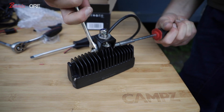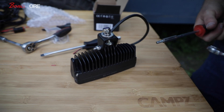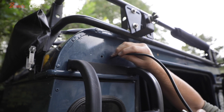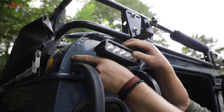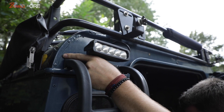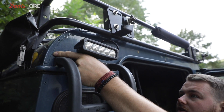A little tip I'd say is to do this up on the bench because it's quite hard to do once it's on the truck. So get it up nice and tight and then you don't have to adjust it again. So you've got the two holes here — obviously you want to do the cable first so you don't have to mess around after. Thread that through just loosely and then the other one goes through there. You've got the bigger washer on the back, followed by the sprung washer and then the nylock which is a 13mm. It just does up on the back nice and easy, which is good.